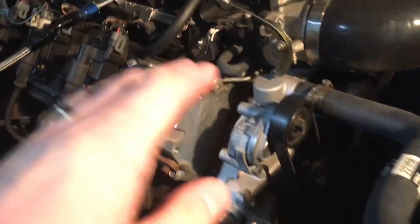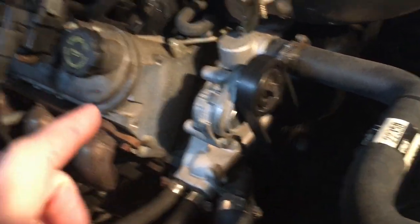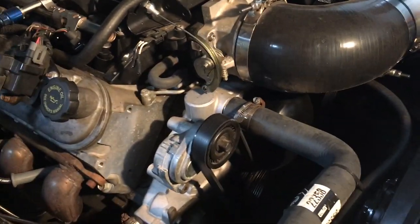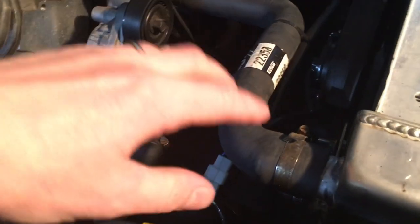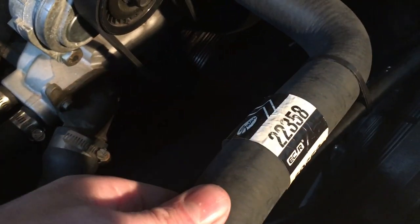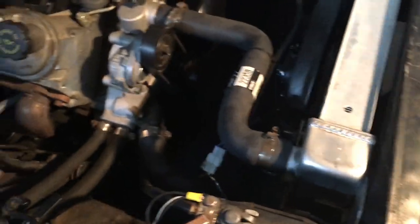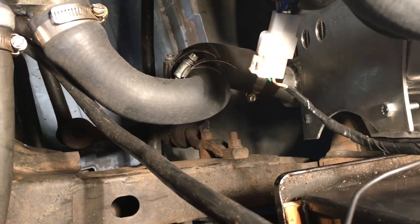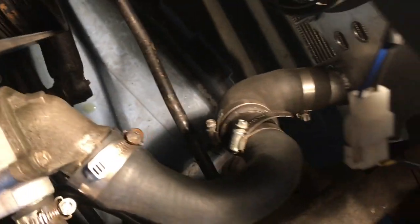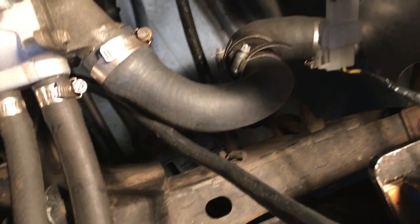I also have all of the Camaro accessories — a Camaro harmonic balancer, the Camaro water pump, Camaro power steering pump and alternator. For the hoses, I went to an auto parts store and ended up just picking some off the shelf. The top hose is part number 22358 from Gates. The bottom one is actually a mishmash — it's two different size hoses, because the bottom radiator hose is larger than the water pump side. I made an adapter for the center that goes from about one and a half inches to one and a quarter inches.